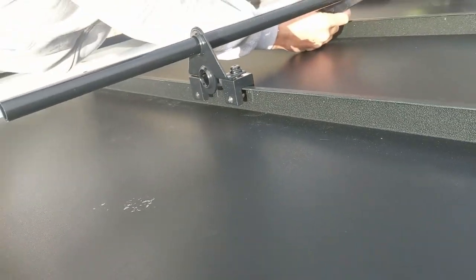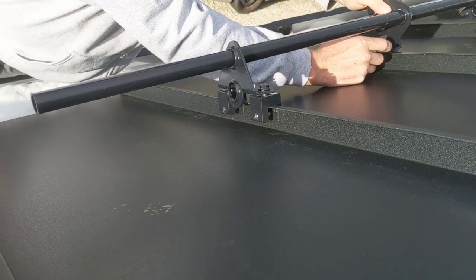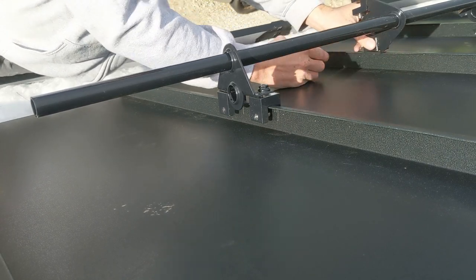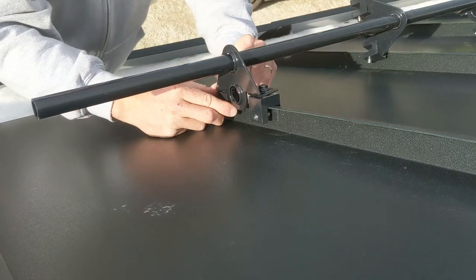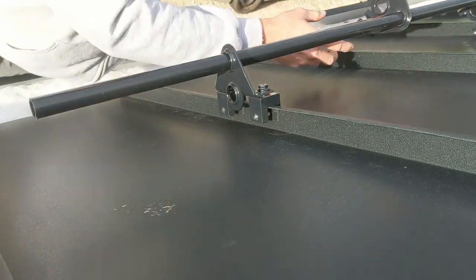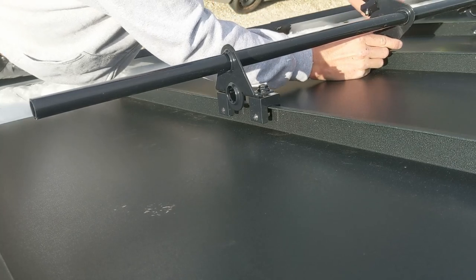Fully compressed the seat. You can draw these bolts all the way through and you have to fully compress the seat. Yeah, don't be afraid to tighten them down.